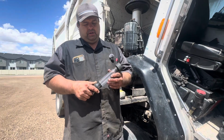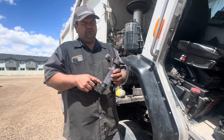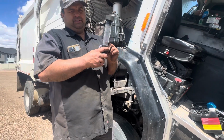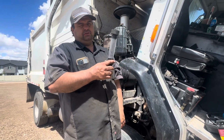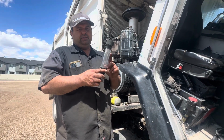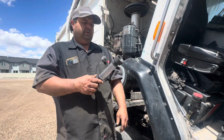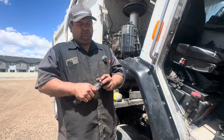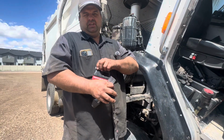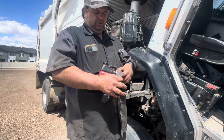your radiator. And so we're going to use this tool right here. You can buy this at your auto parts, and you fill it with fluid to this line, and then it sniffs the gases in the coolant and it changes colors depending on if it's combustion gas or not. And at least that gives you a direction to go. It doesn't fix the problem, doesn't tell you everything, but at least you know you got combustion gas or you don't. So what you do is you pour this stuff in here.